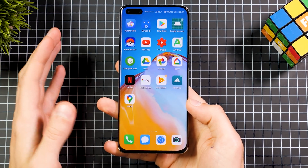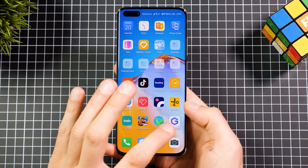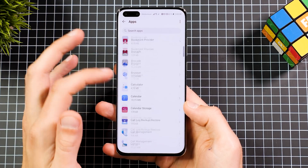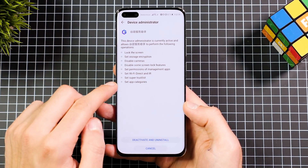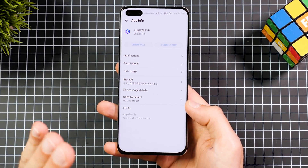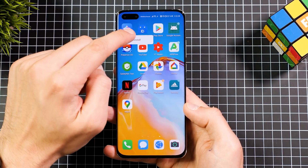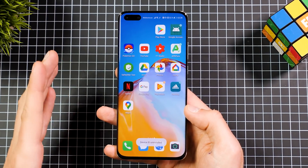Before you do anything with your new smartphone with Google Services, you have to uninstall the device administrator. Go to Settings, go to Apps, scroll all the way down because it has a Chinese name — it should be at the bottom. Uninstall it; it will also deactivate the Chinese device administrator, which is very important. You can restart the phone and download updates from Google — it won't break the Google installation. I've also included a few other apps in the backup like an app store and a device ID app, which you can uninstall.